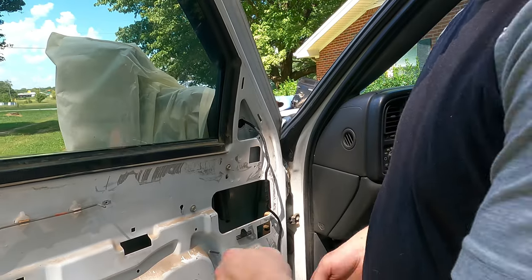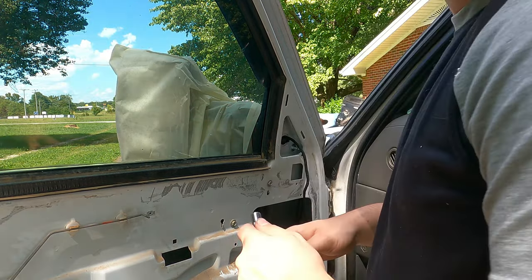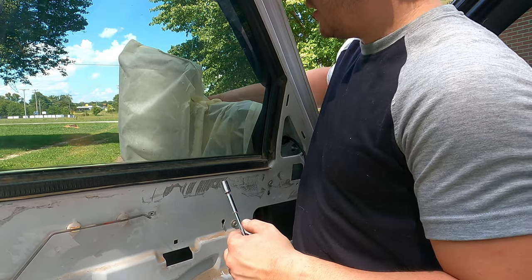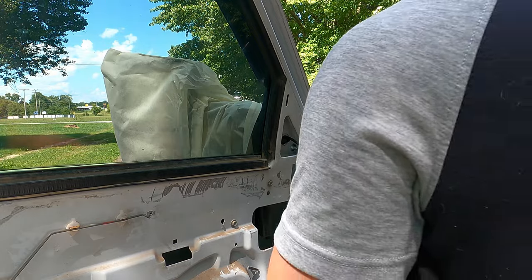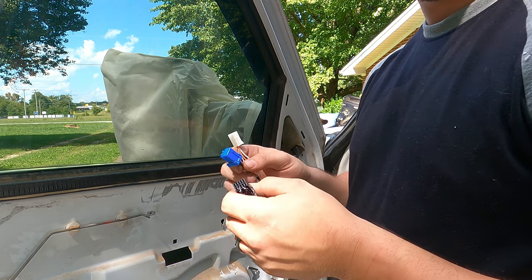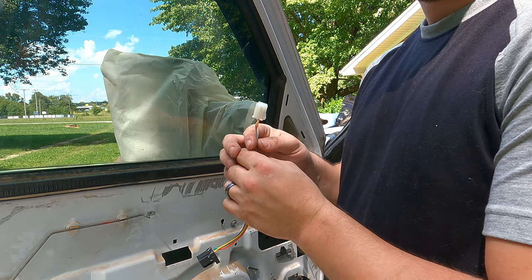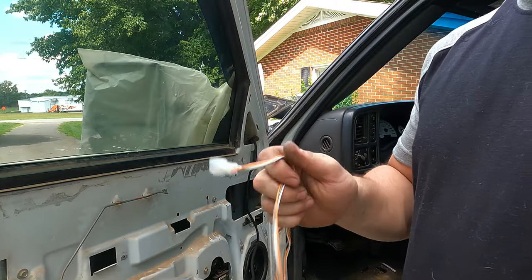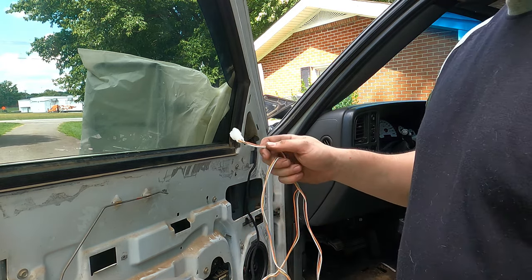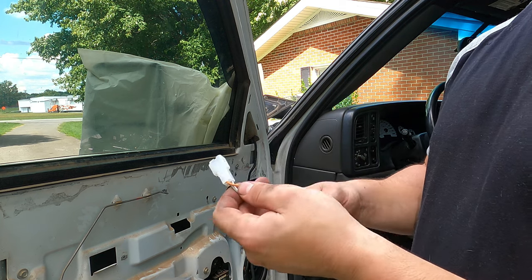While supporting the mirror I'm going to come through and thread on the top bolt far enough that it starts to hold the mirror on. Back on the inside I'm going to put on the rest of the bolts. The mirror itself is installed — that's a win. Now we can get into the connections. The blue and black plug goes straight into your door panel and handles your blinkers and all that — all plug and play. Then the orange, white, and gray are for your floods and other functions.